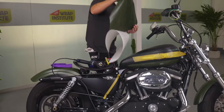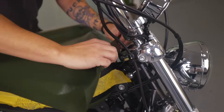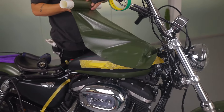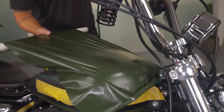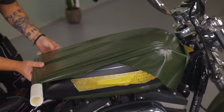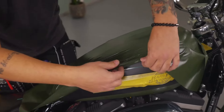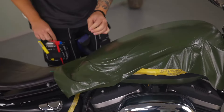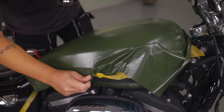It's very important to start at the curvy section first. Pick the material up and feed it around towards the front side. Tuck it in safely, and once it's set at the front, even out the tension left to right. A good tip is to roll the backing paper into a tube so it acts like a handle. Double check that the front is even, then heat and gently pull the material towards the back. This is part of the Wrap Matrix and zero stretch technique from the Wrap Institute — the material literally shrinks while being pulled. Once the middle portion is stretched down, finish the sides, which in many cases will snap very close to the outside edge. Once the material is evenly pulled across the top face, squeegee and lock it into place. For the sides, pick it up, shrink it back right to the knifeless tape, and see how quickly it snaps to the edge.